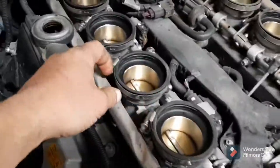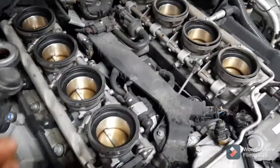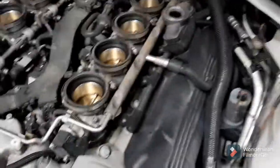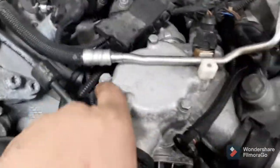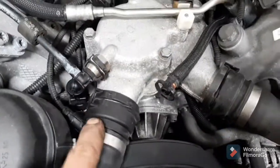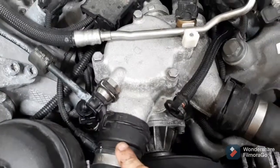It's pretty easy. Just remove all these hose clamps — you can get to them from the side here without a problem. On this side, pull the air box out and then you can get to all of these clamps and then these bolts for the thermostat. Pull the upper radiator hose, this hose, and this hose all off this housing.